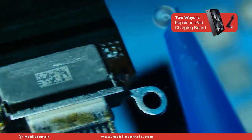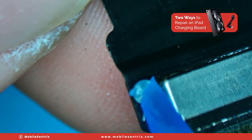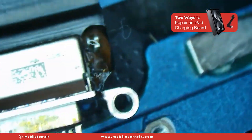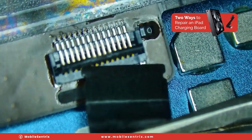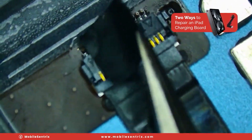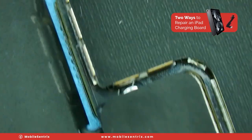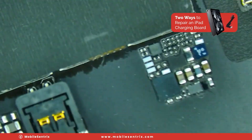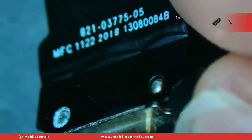The last thing I'm going to do is put on some new glue to cover up these components — doesn't have to be pretty, just has to get the job done. We'll reinstall the port in the frame, screw it down, reinsert the flex into the ZIF connector, smooth out the flex, put the sticker back, and put this one back as well. We'll take out the plastic piece that's protecting the battery from making contact once we've got the display and digitizer reconnected.